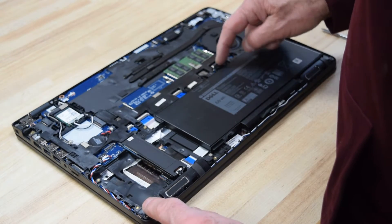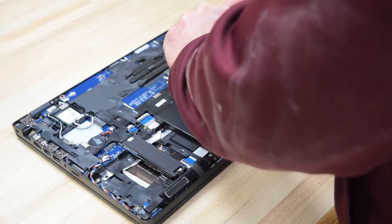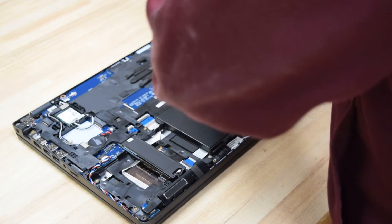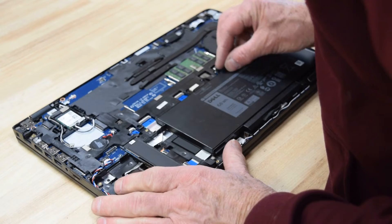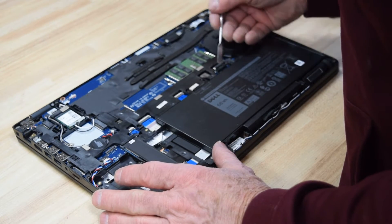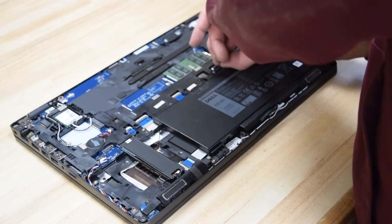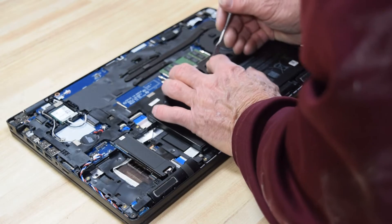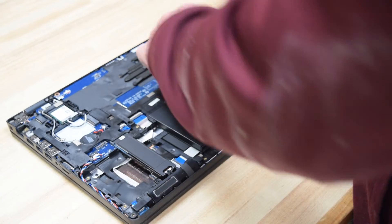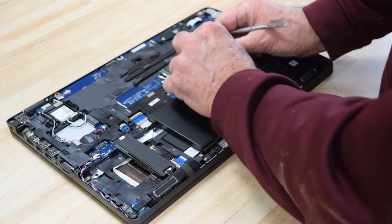There's the battery. It has an electrical connector to the motherboard. You just pull that off — it's got a little loop on it. If you can get your finger in the loop, you just pull up on it. This connector is just pressed onto the motherboard. Get a hold of the loop — it's just a loop of material. Put your finger in it; it's there to assist you to pull it up. Now you can see the little loop once it's off.